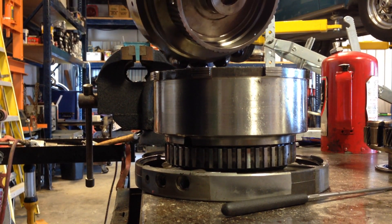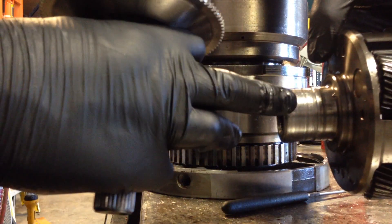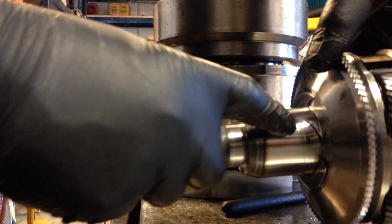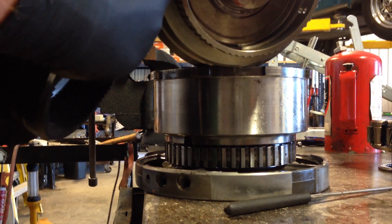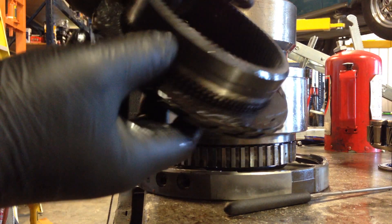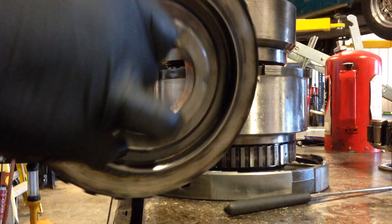The gear train is wobbling at many thousand RPMs, and this galls up. Running off center was enough to fracture this hub, and it's all running off center — wears out the drum here, the sealing, so it cuts back oil pressure to the forward clutch. That was the end of forward movement. That burnt out these clutches. Good clutches look like that, and there should be actual lining on here — nothing there.